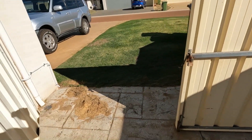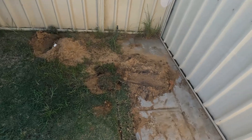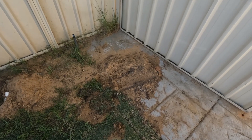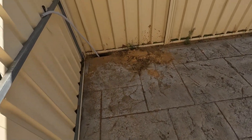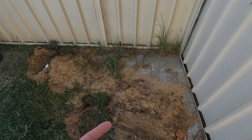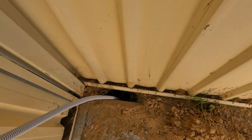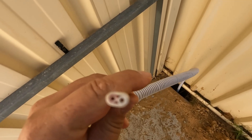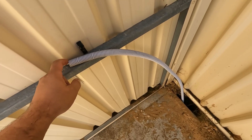I needed two RAMs for the twin kit. I had to dig up and run conduit underneath the concrete slab. I managed to get the power — the 24-volt wires — to the other side by taping a garden hose to a piece of conduit and using it like a lance, digging its way under with water pressure. It came out the other side. It's just a two-core 1.5mm wire, the same as what came with the kit, but I had to buy longer ones.